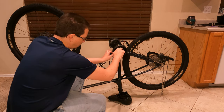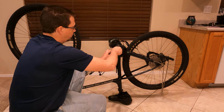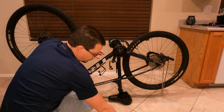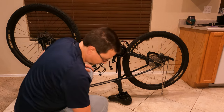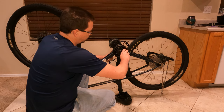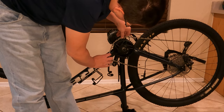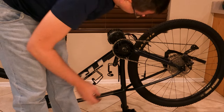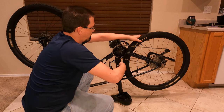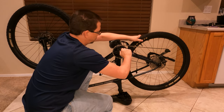I've got thread locker on these bolts. They actually provided one extra bolt, which is better than being one short. I got them loosely on, now I'm tightening them in a star pattern. I'm also going to put the chain back on the chain ring to help get a little more torque down on these bolts.